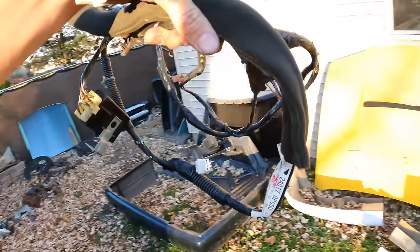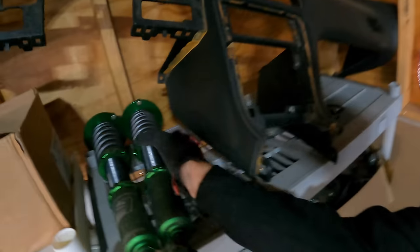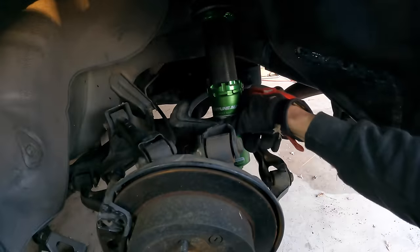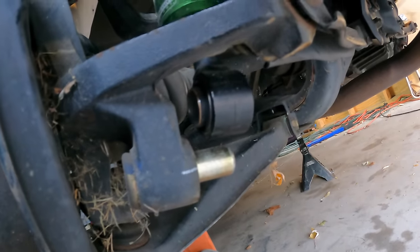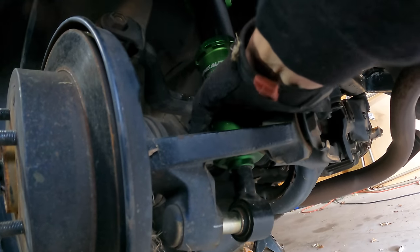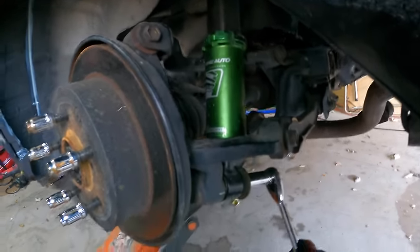The other side — snipped too. It's a good thing we kept the other one. The gift that keeps on giving. We should have enough wires connected to at least get this thing running. But I just remembered we forgot to install the coilovers back onto the car. Luckily, these are pretty easy to do, and I left the hardware on top so I don't need to go searching for it. I like to start the nuts on top so they're hanging. I don't tighten them all the way — that way I have enough wiggle room to install it. Then I'll jack up the knuckle. I also like to tighten this while there's tension on the knuckle, especially because this is a rubber bushing. If you tighten it at full droop, that could prematurely cause that bushing to fail.